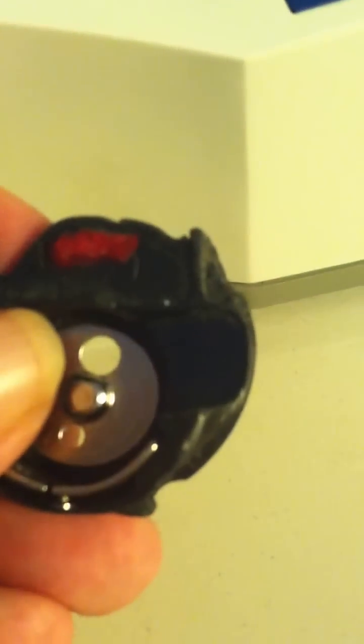Now, this is a used one, and I do save mine in case I get desperate. But you will see, like right here, and right over here, there's been quite a bit of little nicks and dings going on. Also, under here, there is another place. I have these issues with the bobbin casing, and then the next thing you know, it's breaking needles, it's jumping out of place. Every time you get one of these little nicks, that thread is going to snag on it, and it's going to rip it up and make it jump out of place, and in most cases break your needle. So I wanted to go over a few things that I have found.